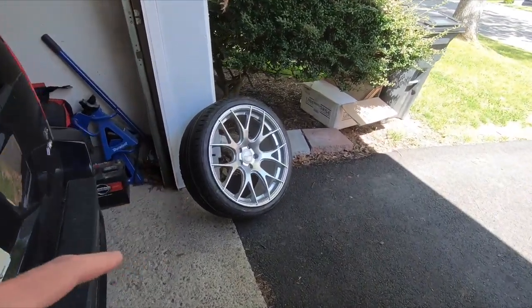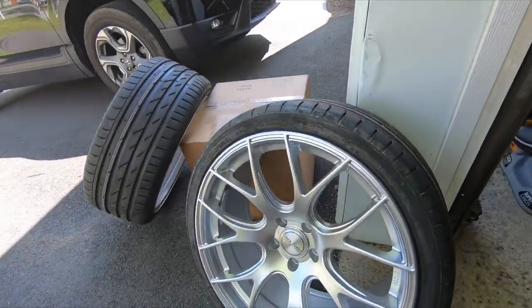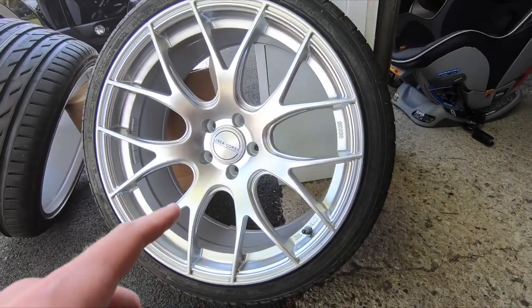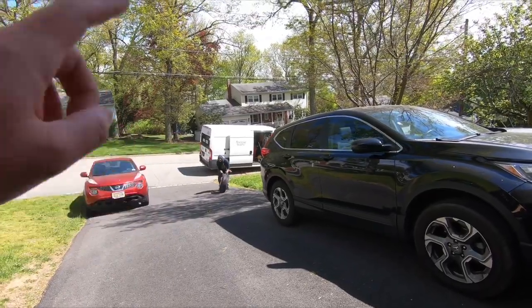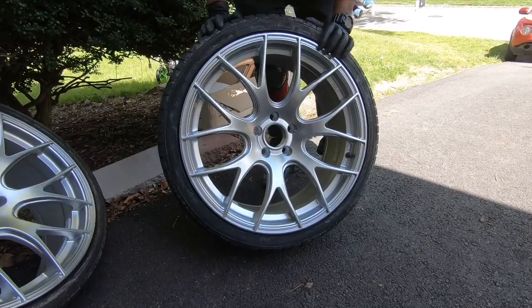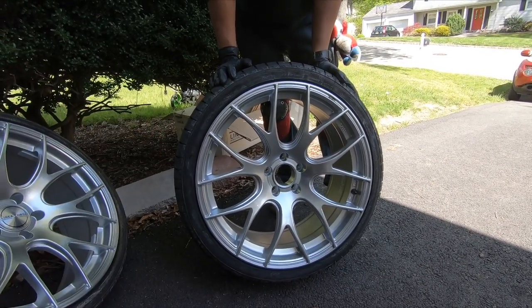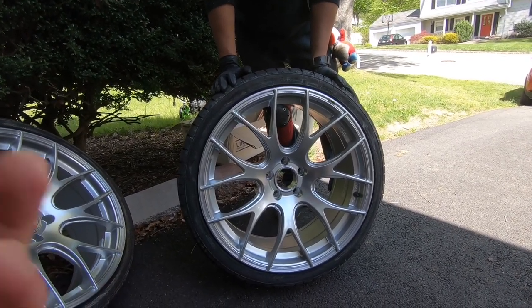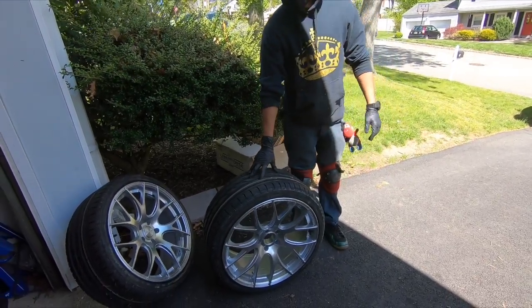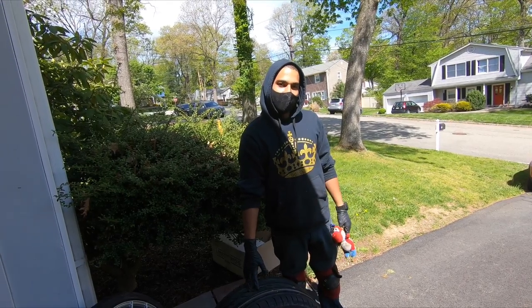In an unexpected turn of events, these wheels actually couldn't get on the tires in the truck, but we got them to the shop and got them back — so thank you so much, they look so good. Huge shout out to Momentum Tire and Wheel in West Caldwell, New Jersey to Edgar and Frankie. These look like they came out great. Just so you know, if you're mounting wheels with 35-section sidewalls, that may be a little too tight for some mobile installation machines. But if you go to a shop they should be able to do these, no problem — which is exactly what Momentum Tire and Wheel did. If you're in the New Jersey/New York area, definitely check them out. I'll drop all their info in the description below.